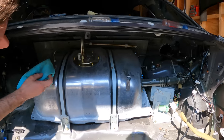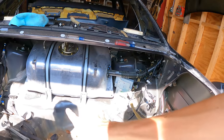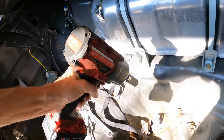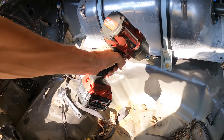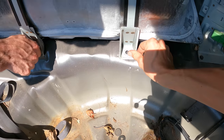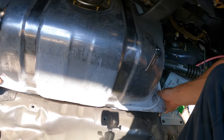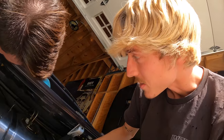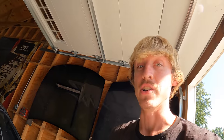She's all free. Unbolt the filler neck — these are still connected to the tank so I'll just unbolt those and slide it out. It's probably a bad idea to use an impact near a fuel tank. Yeah, this thing was not sitting in there happily — you can tell it's so warped. It's got stress on it. Oh my god, how heavy is this thing? It's like stuck on the seam sealer — in there good, you can't even budge it. I don't want to use a pry bar on it.